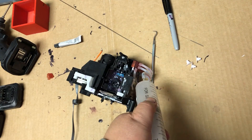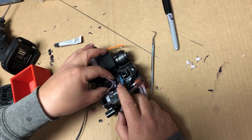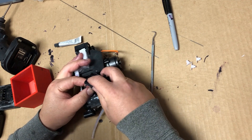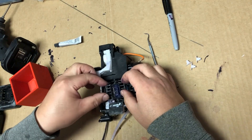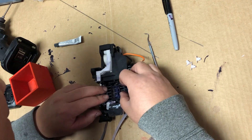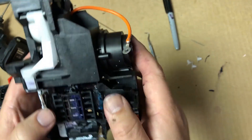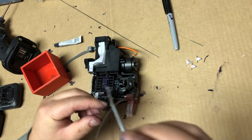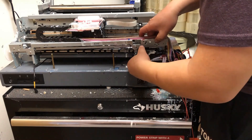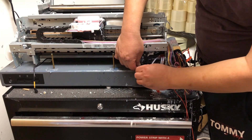Now connect the top three tubes — remember you don't need the clamps anymore, you can just remove them. Now we install the big spring; it has a wire in the middle, so that's how you match it up and put it there. At the platform, you need to attach the tube first. Remember: left is the ink tube and right is the air tube. The platform has two short legs on the back — slide those two in first. Then in the front there's one big tab — push it from the left side all the way down, then slide to the middle. Now install the little spring. Then slide the capping station in. Connect the waste ink outlet — this big tube connects to the tube extension so the waste tube goes all the way to the back and connects to the main board.